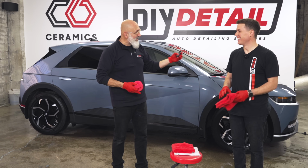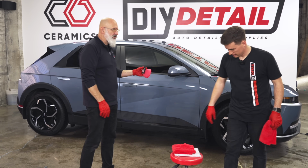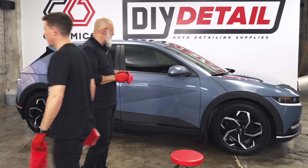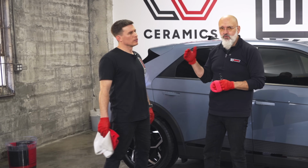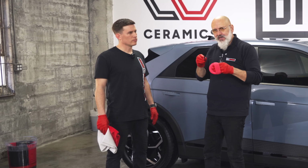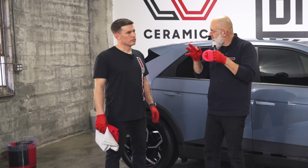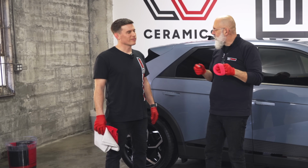Yeah. So I have the 8-year coating. I have our foam applicator. We have 2 towels. Are you applying or wiping? I like to level. Okay, leveling it is. And when we say leveling, we really mean leveling. He's not removing any coating from the surface. We have to wait just enough that we get cross-linking. That cross-linking fades away, and when it's faded, then we're ready to level.